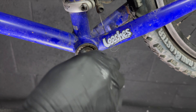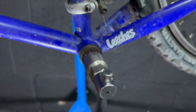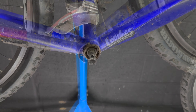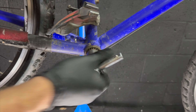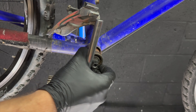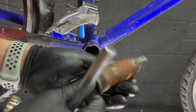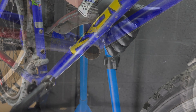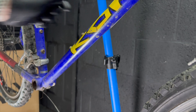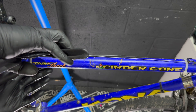Maybe I'll do like a charity bike build with the odd chainset — it'll come out of my spare parts bin that way. The bottom bracket itself actually felt pretty good despite looking super crusty. That side came out fine — no issues. The plastic side is never really an issue; it's where metal meets metal on the drive side where you usually get the problems. But for a change this one came out easy. It's pretty rusty on the inside — it's obviously had water and muck thrown down the seat tube.